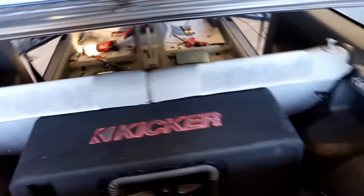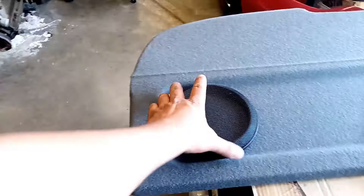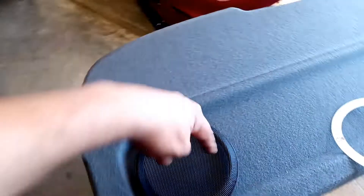We're going to modify the rear — it's kind of like a rear dash that goes right across here, and it's removable. We're going to put in a watertight connection in case you want to remove it. It's the best place for speakers without major modification. I think in these side panels there used to be speakers, but only if you optioned them out. Since the grille isn't there, it's harder to shape a grille to that form than it is to put them back here. Basically, we're going to have these speakers here, and if the customer wishes, we can paint them to match — gray them out so there's no distinction. We're going to go ahead and make the holes for them here.